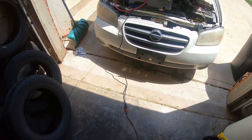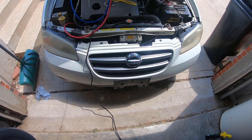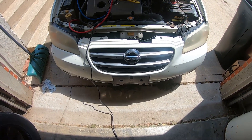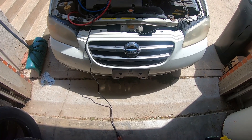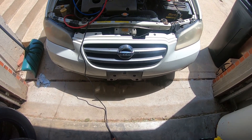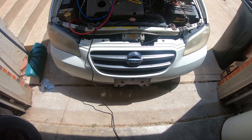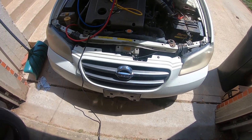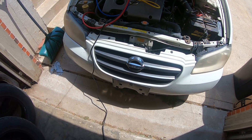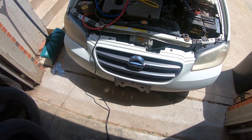Hello again everybody. I'm starting another project — this is my son's 2003 Maxima and the AC quit working. It was fine last season, weak at the beginning of this season. Tried the can recharge and it wasn't going anywhere. We took it to a well-known reputable shop in town and they diagnosed it as having a leak in the high pressure line — a Schrader valve leak.